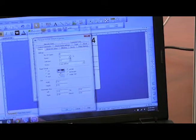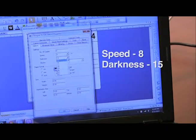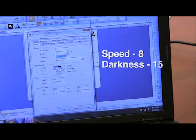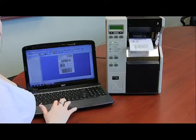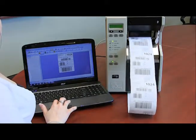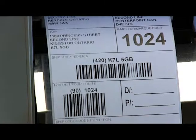All thermal printers have a range of speeds from fast to slow. Choosing slower speed settings will likely increase the life of your printhead. Here, a faster speed of 8 inches per second was chosen. The results are that smaller type is broken and too light.